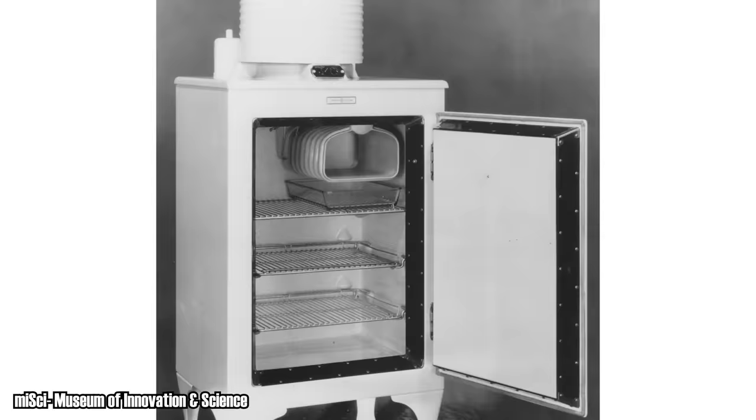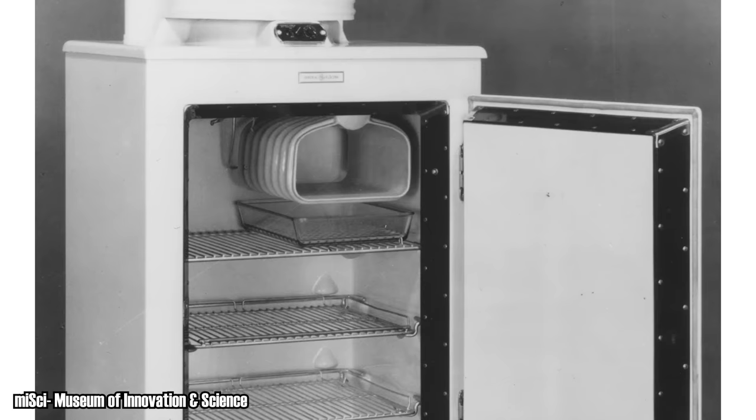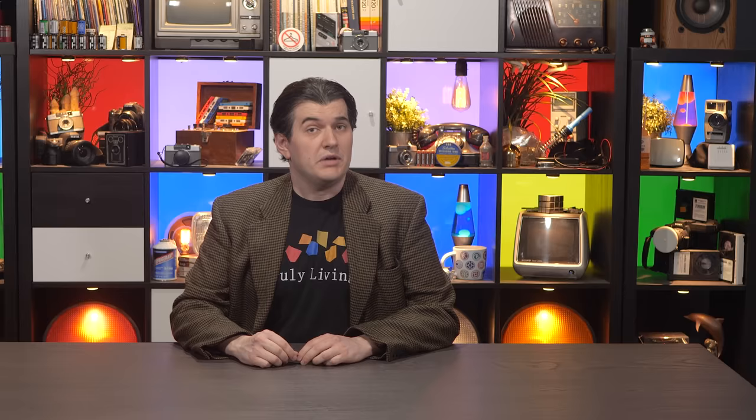For best results, make sure you put the cold part at the top of the box so that as it chills the surrounding air, that air gets more dense, sinks to the bottom, and mixes it around real good. And if you make the shape of the thing that gets cold into a little compartment that mostly separates the air inside from the rest of the fridge, it will stay so cold inside of there that you could make ice cubes! This design may be basic, but plenty of mini-fridges are on the market today that are essentially this exact design. So hey, it works!